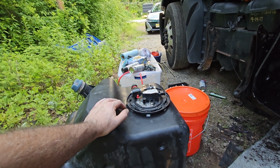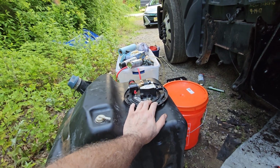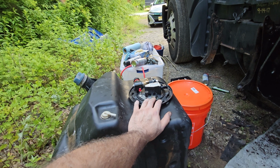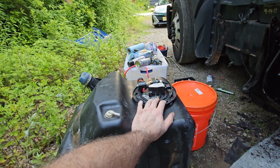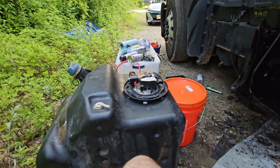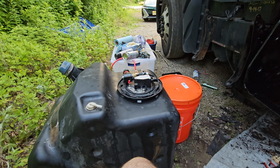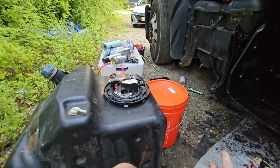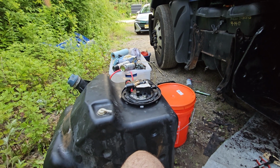Anyway, it ran probably 2-3 months. Every time he would fill the tank with fuel, he would fill up the DEF. But lately we were having a problem with the quality of the DEF. Once he stopped at a TA somewhere in Mid America, I think in Arizona or somewhere in that area, the check engine and amber lights came on. I always have the computer, and remotely I am able to access my truck and get the diagnostics, all this stuff. He was still at the truck stop, and we had to recycle this, take out the DEF, and put in a good quality one.